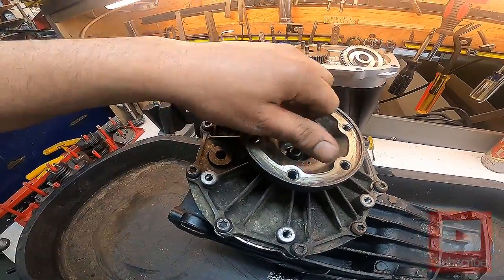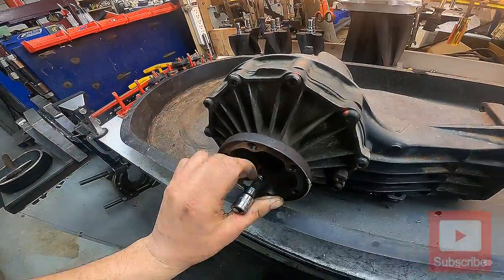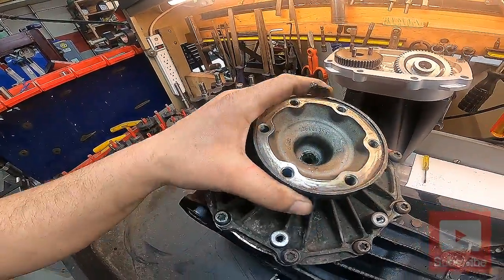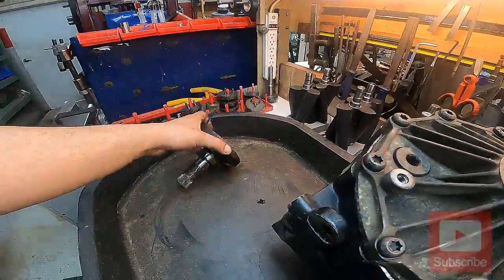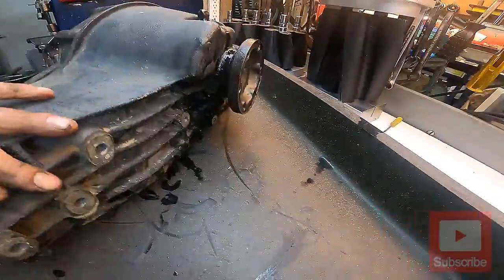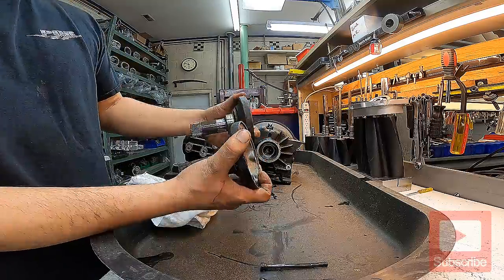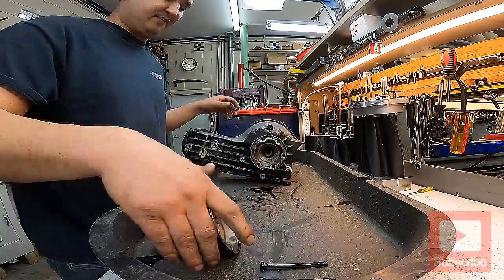Six mil — just want to take both of those out. I've already loosened this one up so I am cheating a little bit, but I did that so I can show you guys what's going to happen. Take this out, set it off to the side, and then this axle cup is just going to come right out. Set it to the side. Do the same on the other side. For the record, these are not side specific — I have got them backwards before without any problems.